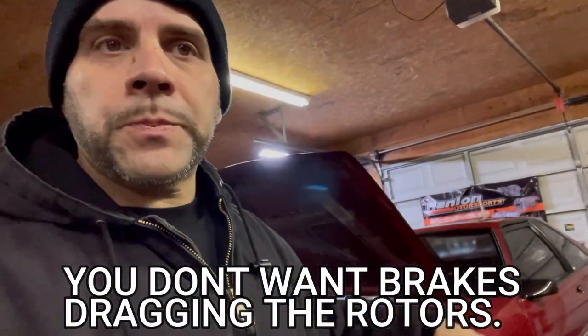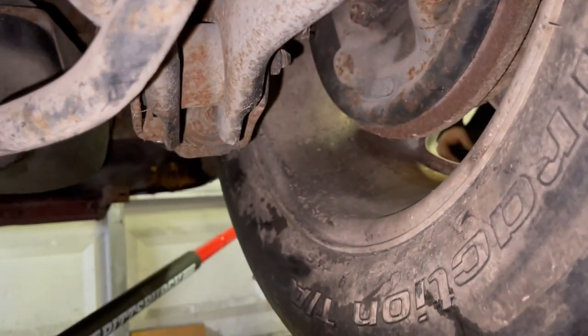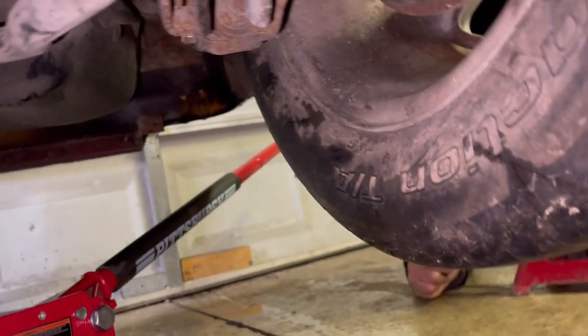This is particularly useful for people who mess around in Fox bodies all the time. You've got to have both wheels spinning at the same time. When I start to spin them, all I've got to do is count the differential rotations — marked in two spots. What I'm going to do is mark the differential and the inside of the tire right here. It's going to be pretty easy to do.